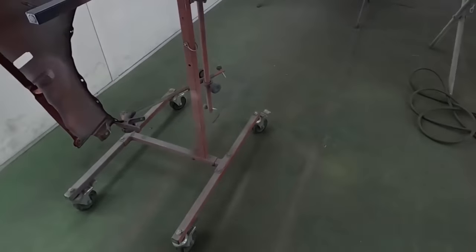Now, what I like to do is try my best to walk a panel when using this type of color, and that's really gonna help keep everything as even as possible. I'm running around 80% overlap, but what I'm really doing, guys, is I'm watching the paint and I'm adjusting. If it's not covering enough, then I'll increase my overlap, and then vice versa. Guys, first coat down. The worst thing you can do with this situation is try to jump into another coat. Let this flash. It's already starting to flash.